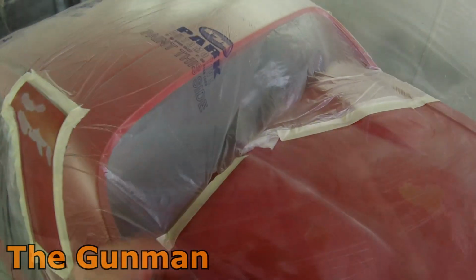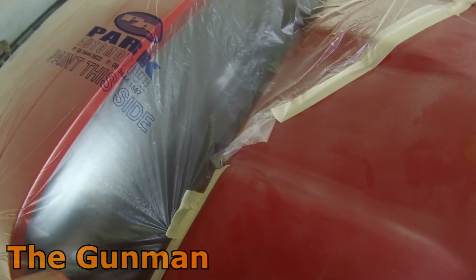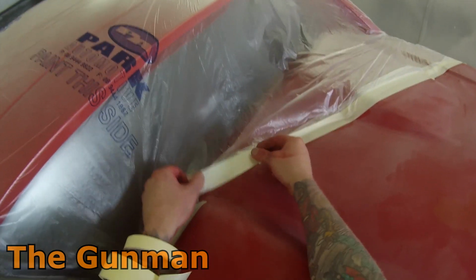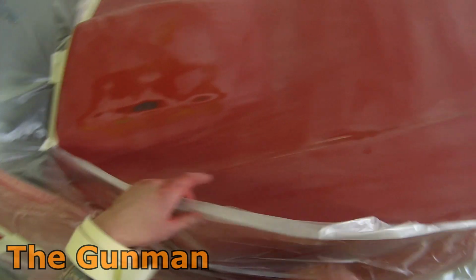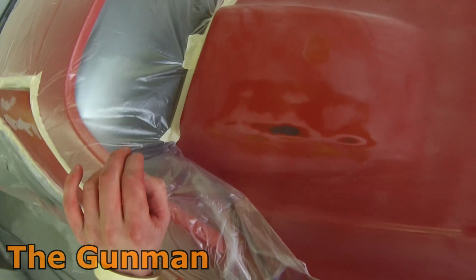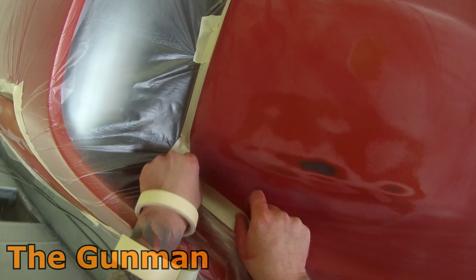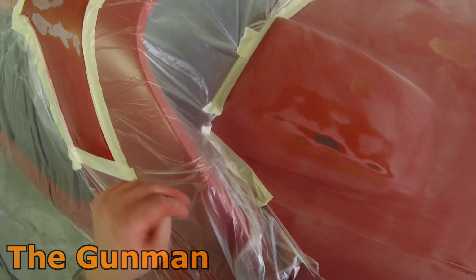Now you do have to be careful with some of these factory plastics. I'm not sure if it's the plastic, but I'm probably more inclined to say that it would be the kind of paint or even the kind of plastic primer that they use. I would highly recommend using 2-pack primer on all these kinds of factory plastic parts, because if you use 1K primer, you'll get it in the booth, all happy days, put your first coat of base coat on, maybe a touch too heavy, and then it'll just fry up, and you've got bad days ahead, bad times.